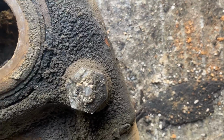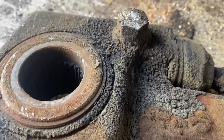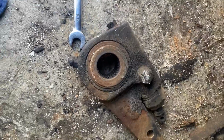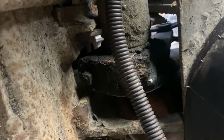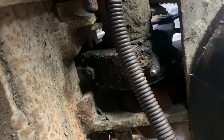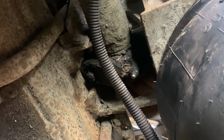But that little bolt on the side right there, if you pull that out, you can't put a pawl behind it like the other ones. So I tightened it down until the brake drum wouldn't turn, then backed it off a half a turn, and then it's not in a very good spot to get to. Ty's putting the center back in it now. Is it back in? No. It's fun, huh? You can't get to it.